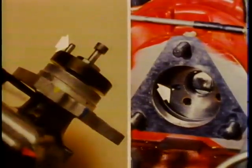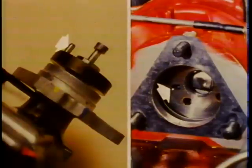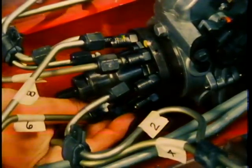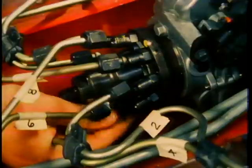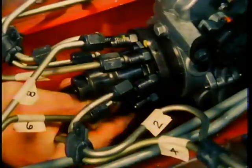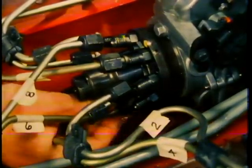For installing the pump, there are a few important points to remember. Make sure that you line up the locating pin so that it goes into the correct hole in the drive gear — take extra care doing this; otherwise you'll end up with a locating pin in one of the bolt holes. Also make sure that the pump and front housing assembly are aligned according to how you marked them. Once the pump is installed, remove the paint marks used for alignment. When connecting the fuel delivery lines at the pump, connect the ones on the bottom first — if you connect the top ones first, you won't have enough room to get to the bottom ones. Complete the rest of the installation and connect all wires and hoses to the pump.